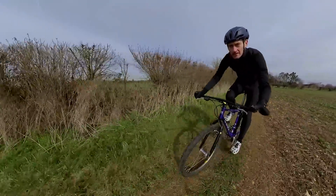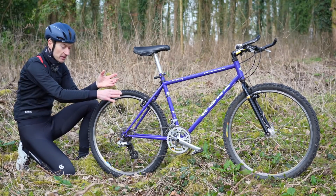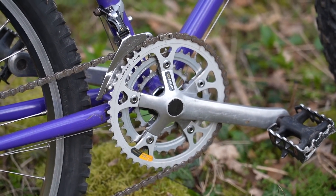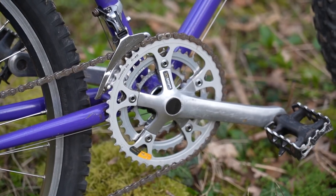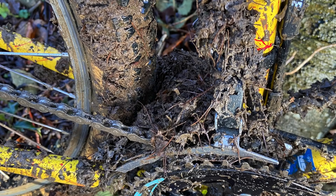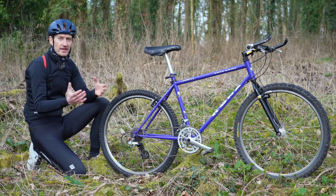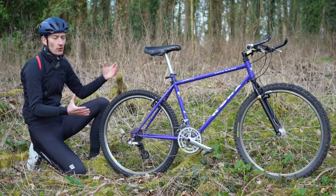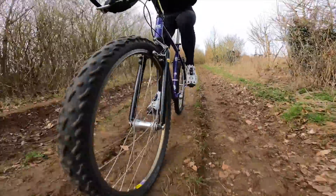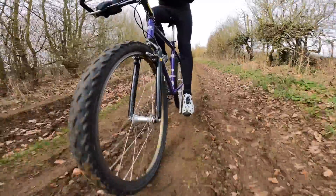The gears work okay considering their age — they still change gear okay. But you have three changes at the front to manage, which is quite tricky, and only seven sprockets at the back. So while the range isn't so bad, you spend a lot of time changing gear trying to find the right one. And in the mud, that triple chainset with the front mech really clogs up compared to the simplicity of the one-by on a gravel bike. For riding tame trails — gravel tracks and forest trails that were everywhere back in the 90s before trail centres were ever developed — the bike was fine and it still rides okay on those sort of trails today.